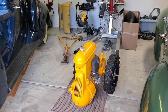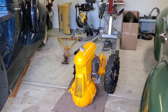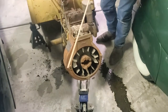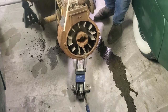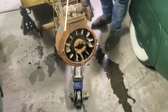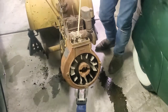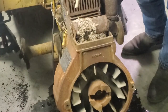Here we are with the current state of the rototiller. We had originally planned to try to start it in the rough condition it was in, but as you can see we've taken a few things apart — largely because down here you'll see an entire oil slick. We concluded it needed a whole new set of oil seals. While disassembling it we found all this mouse lint and garbage inside, and more up here too. Had we tried to start it in that condition we'd probably have had a fire.